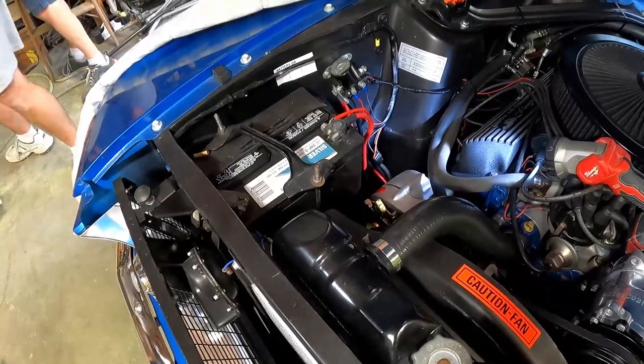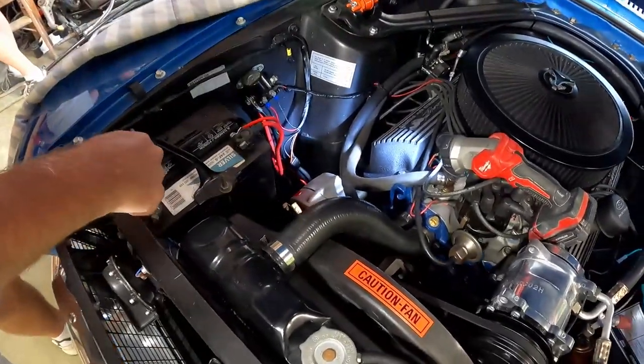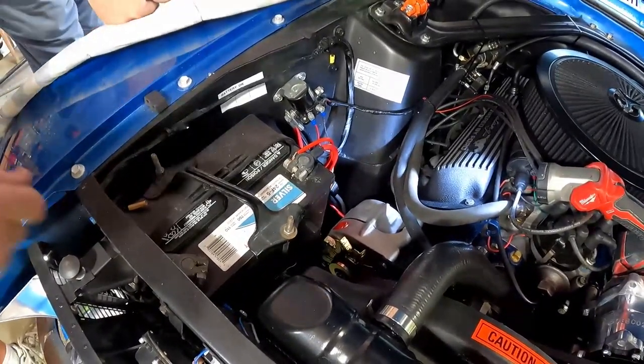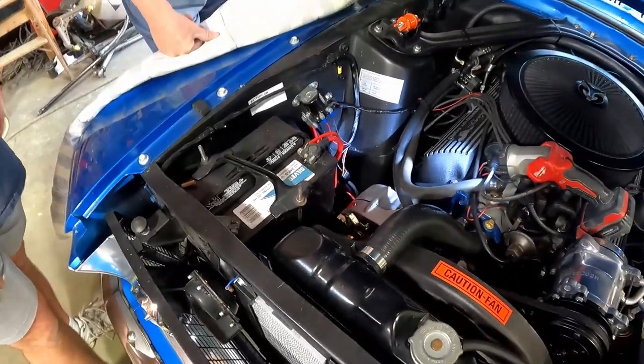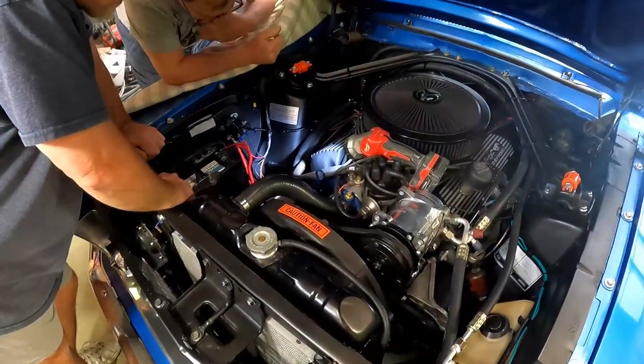Is that why we're replacing your alternator? Well, no, because we just did and it's still doing it. It would be more than one tiny little spark. If you keep moving, that could be the clock across there, keeping time, pulling that current just a little. Yeah, in the radio. Gotcha. Okay.